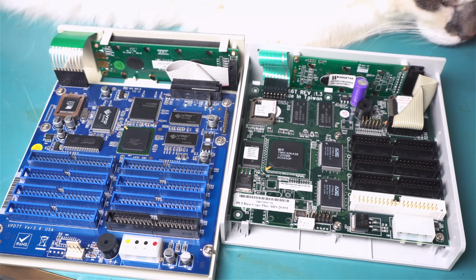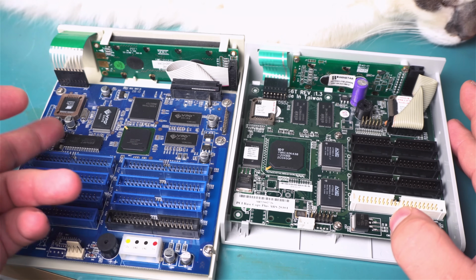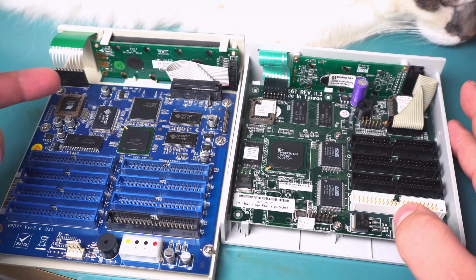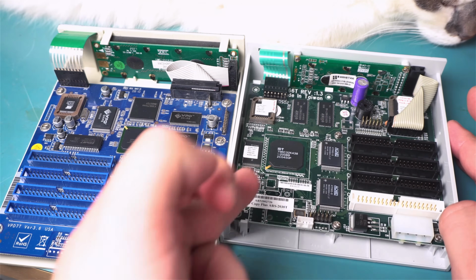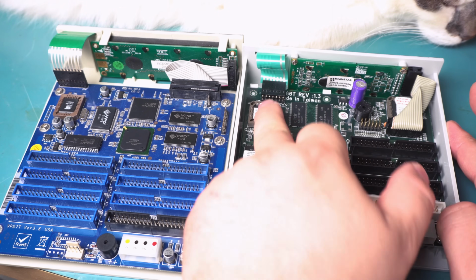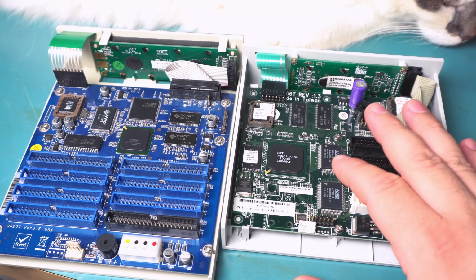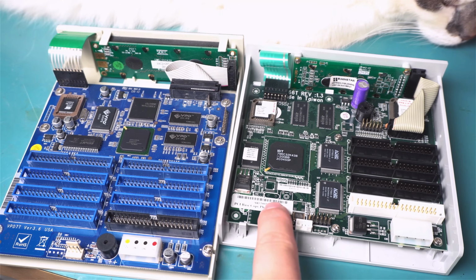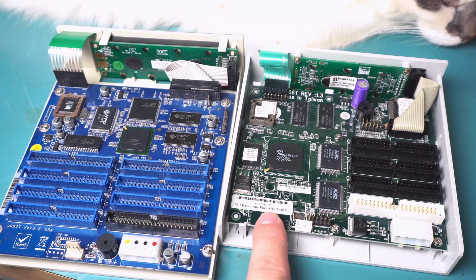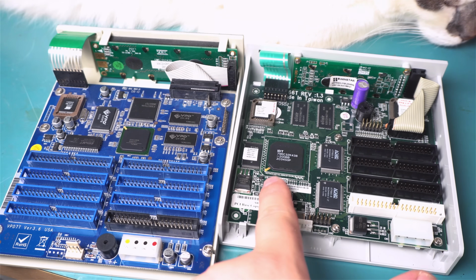Basically have the same architecture where they have some memory, probably more memory. This looks like it's 100 megahertz DRAM, a BIOS. In this case, this one has 3. It's got a flash, standard like Intel NAND flash, and then it's got 2 BIOS chips, so whatever. Different architecture. This one also has an optional Ethernet port. I noticed the layout underneath this sticker looks like it's an Ethernet jack, and then there's a little pad here for presumably a controller or maybe just the PHY.